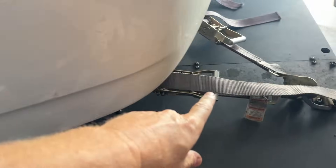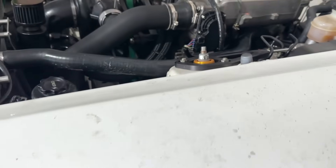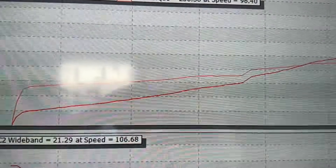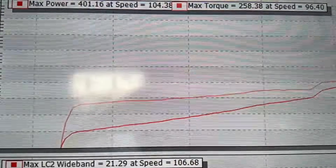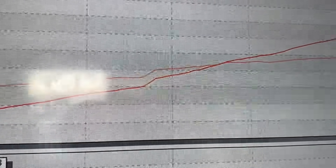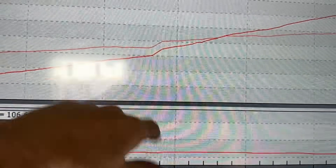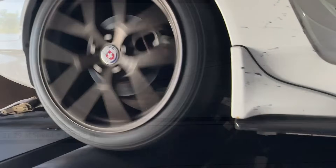George just put it on the dyno — we're strapping it down and plugging in. We always like to be extra cautious with the straps — four straps at the back. I know it's only going to make 400 horsepower but it's always good to have a redundancy setup. Wide-band is in — we'll go from the one on the car and one on the dyno and take an average of the two. That's what it made the last time it was here — a really nice, usable graph. We're not going for absolute peak power, not trying to wring its neck. We might drop the VTEC a little bit, but we usually leave it not too low — the VTEC sensation is part of what makes the car feel like a Honda. The dyno will show it best, but when you drive it the butt dyno tells you that the VTEC works, and people actually like that, so we deliberately keep the VTEC changeover.